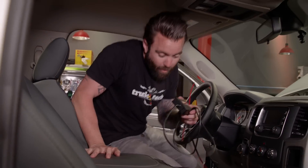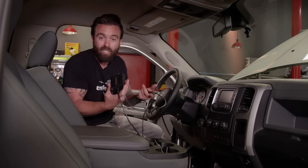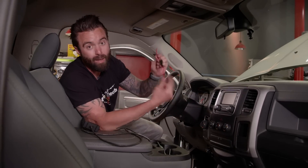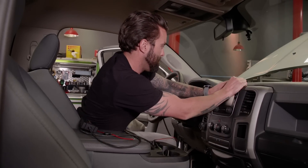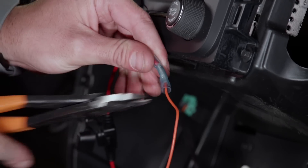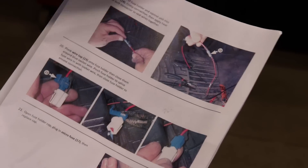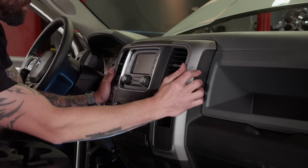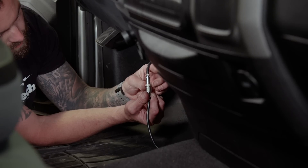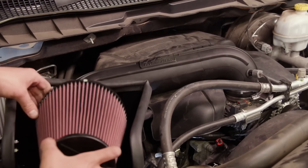All that's left to do is mount the module that's going to send the power to the actuator to turn the system on and off. It's fairly simple — comes with all the wiring harnesses needed. All we're going to do is find a 12-volt power source somewhere behind the dash, tap in with a fuse, and it'll be in business. No worries about any part of this installation. The kit comes with easy-to-read instructions. I already ran the harness under the truck and through the firewall, and it connects straight to the module under the dash.